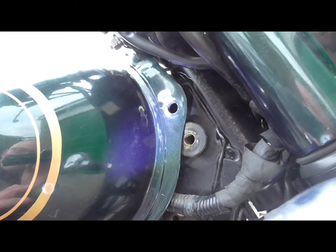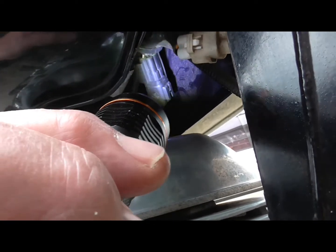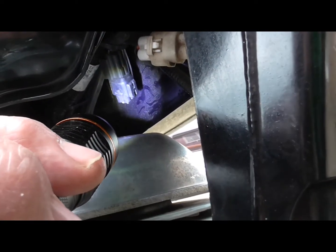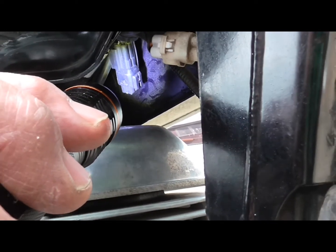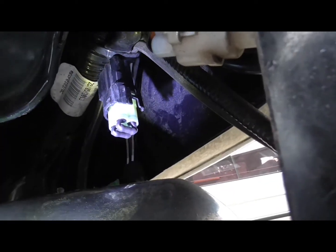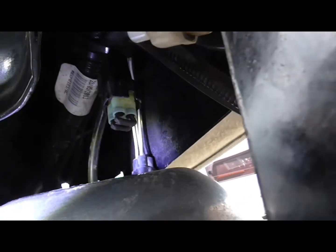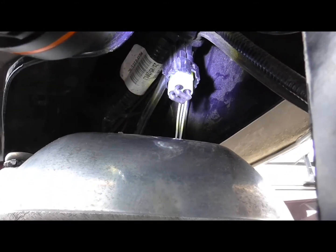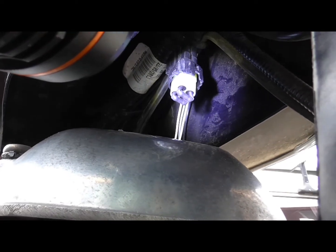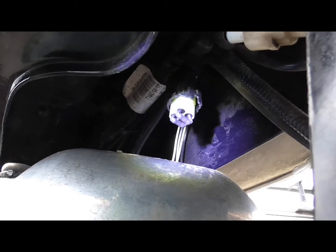Taking the bolt out of the tank — unfortunately the paint was already chipped. The actual plug you can just about see up in there with the aid of a torch, so I'm going to have to fiddle around with that a little bit, pull it out, and plug the little plug in. There it is, plugged in. It's difficult to unplug the original Lambda plug, which is just there at the back. That one doesn't go in very well, but I'd be inclined to put a small tie wrap around it to keep it in place, because you wouldn't want that falling out when you're riding down the road.